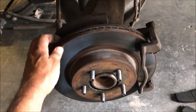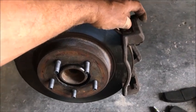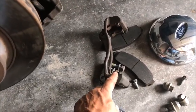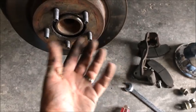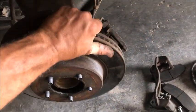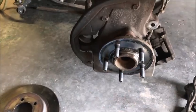Pull the second part of the caliper off to get it fully out of the way, then set the back piece aside. Some brake shoes come with new clips, some do not, so don't pull the old clips off until you've opened your box and confirmed new ones are included. Then grab your old rotor, take it off, set it aside, and set the new rotor on.